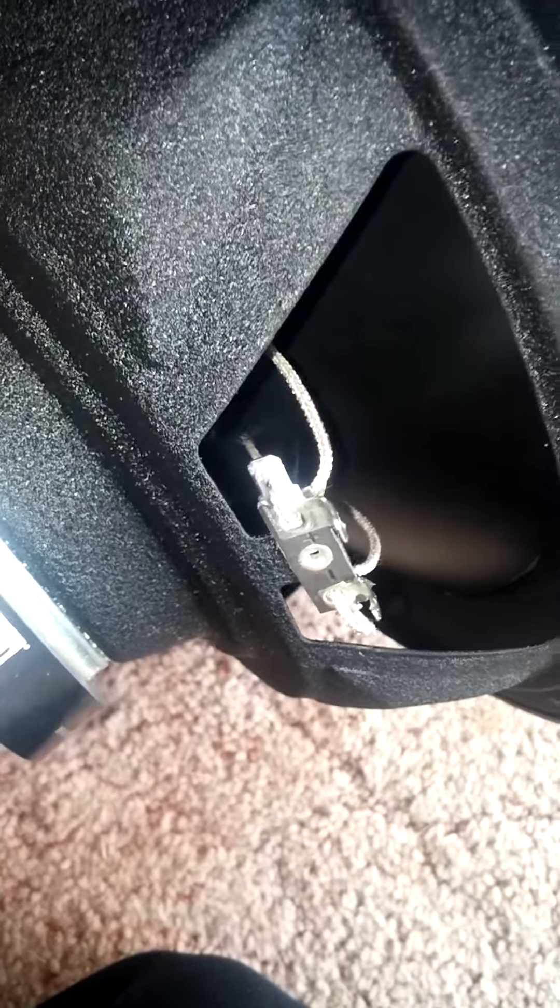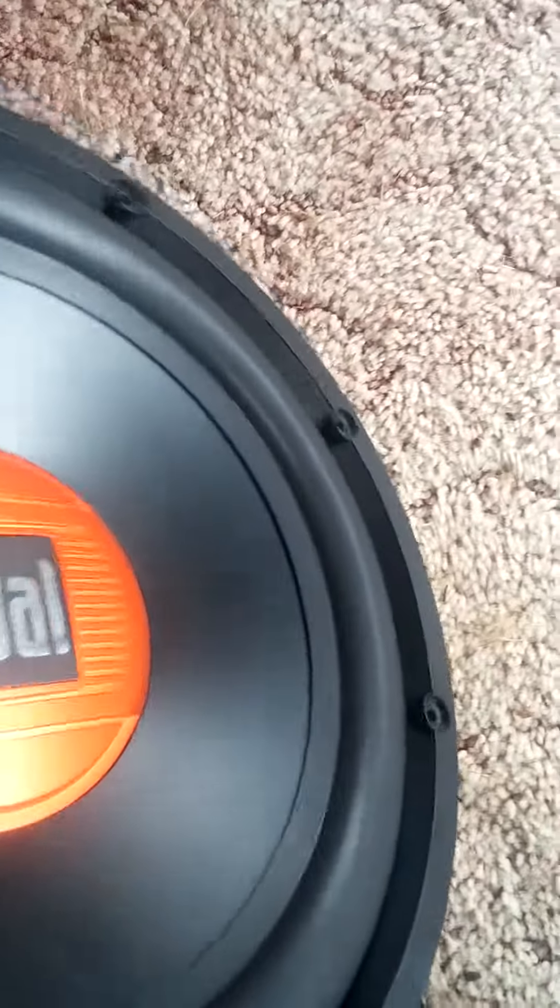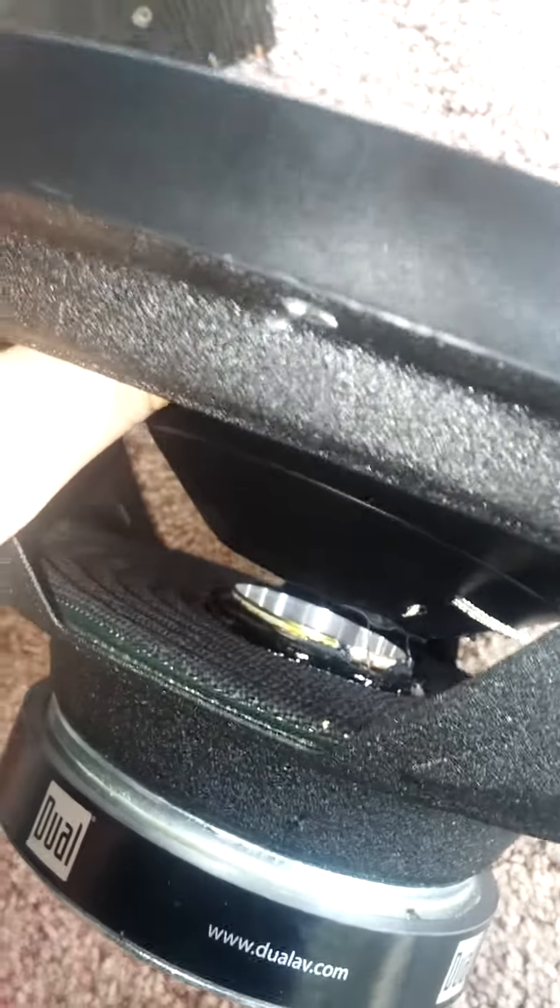So I slightly lifted it up and that's what happened — the wires got ripped off of the coil, connecting to the terminal. I guess when the bass hit too hard, that glue got weak, popped off, and ripped the wires. That's why there's no audio.